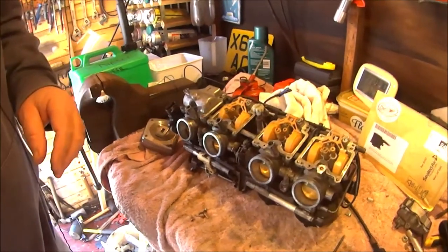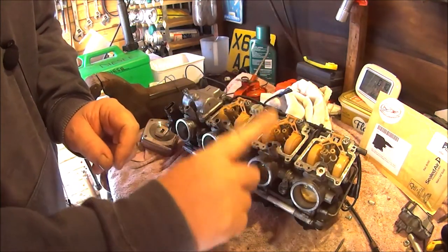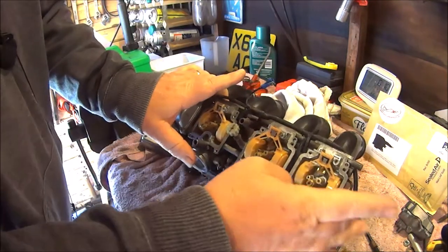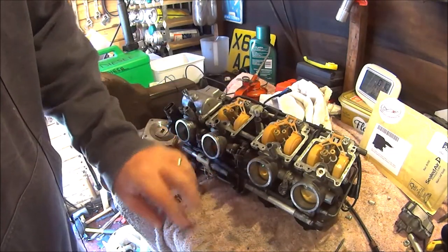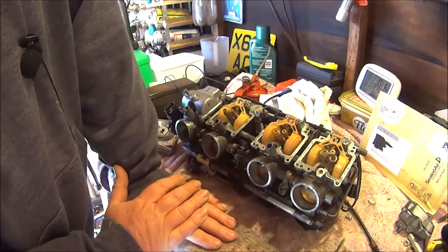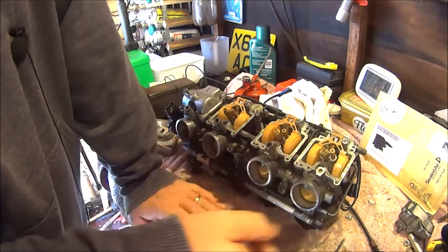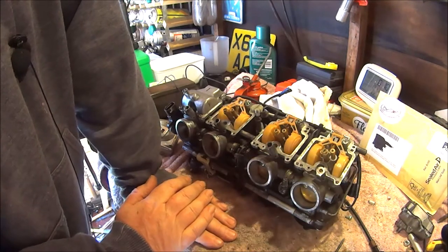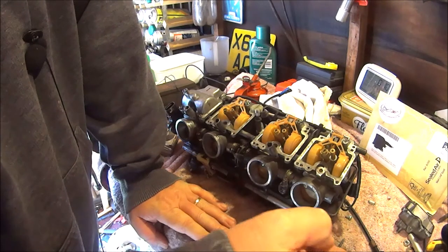Like I said, I was going to do a few weeks ago: take everything out of this carburetor and put it into this one, and everything out of this one and put it into this one. And that's what I did. As we know, this spark plug keeps burning black and sooty. I put it on the bike, started it up, and it ran for a long, long time. I left it running, came back, and all the fuel was pouring out of this one. I cleaned all that up, but it stripped all the paint off my engine very nicely, and my alternator, so I've got to repaint them. Anyway, back to it.